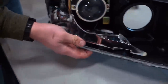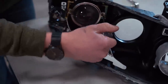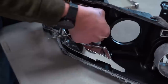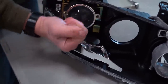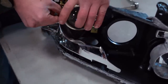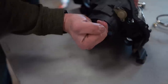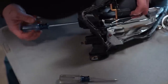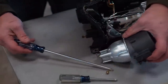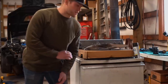One more thing I've been considering doing is painting the cutoff shield inside the projector. I'm going to pull these two screws off the front — it's going to act kind of like a demon eye as well, so when light hits it — like someone else's headlights or the sun — you'll see the blue shining through. It should look pretty sick even when the actual demon eyes are off. I've seen people do it before and always wanted to give it a shot. All we need from this is the cutoff shield — we're going to paint that the same blue color.